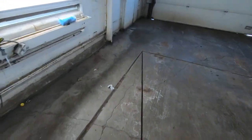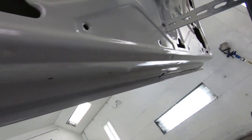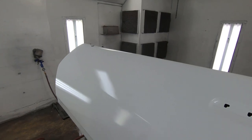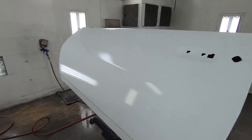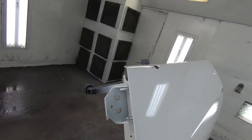Let's go take a little look at how the door is coming along. Just got the third coat of base on it — checking for coverage, maybe do a coat or two more base, we'll see. But white's really easy, covers nice. The bodywork looks just fine. Had to pretty much re-mud the entire door because of how damaged it was in the past, but we got a lot of the old filler out of there so it should hold up for a long time.